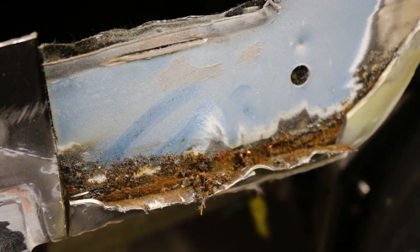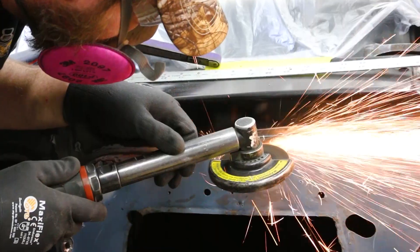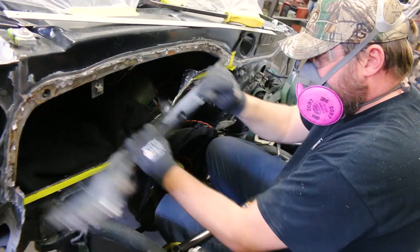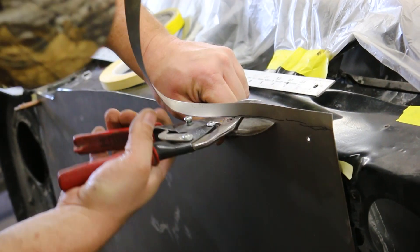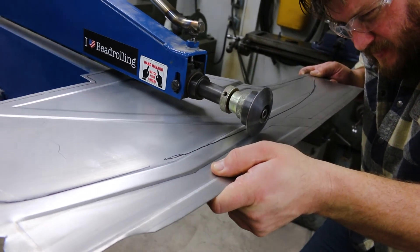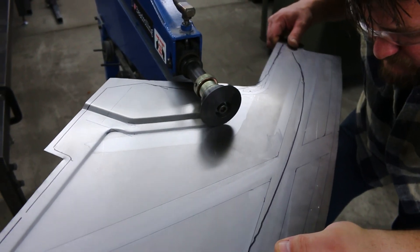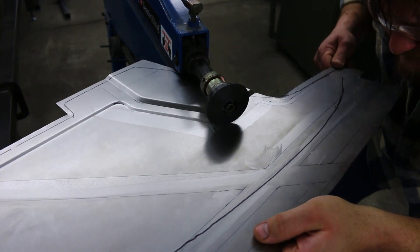The paint was stripped off the old firewall to reveal the ugliness. Not only did it look bad, but it was also holding moisture and rusting from the inside out. The only way to fix this was to completely cut out all the offending metal and replace it. Our fabricator went to work designing a custom firewall featuring reliefs and a geometric design formed in a steel panel using our Mittler Brothers bead roller and our Pullmax power hammer. The contours add strength as well as style. The design was sketched onto 18 gauge steel, cut to fit in place of the old firewall. Keep in mind that the bead roller shrinks the overall size of the panel with every relief rolled into it, so you must compensate by starting with an oversized piece.